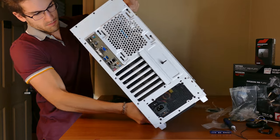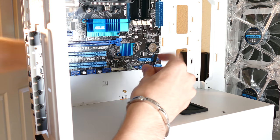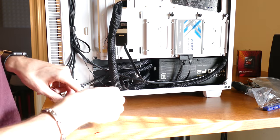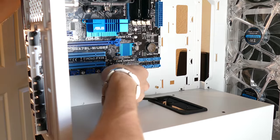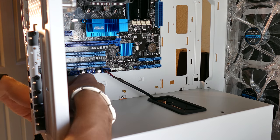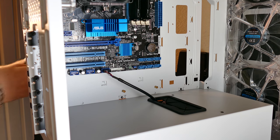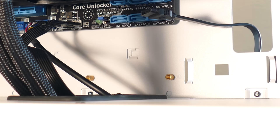Now turn your case back on its feet. There should be a strand of cables along the back of the case that connect to the front I/O ports, USBs, the power and reset buttons, etc. Our motherboard doesn't have a USB 3.0 header, so we can set that blue cable aside. But we do need to wire our hard drive LED, power button, reset button, and power LED leads. There should be a header on the motherboard with corresponding labels down toward the bottom — if it isn't marked, locate it in your manual and connect the cables to their respective pins. Don't forget about the HD audio cable either, which plugs into a header on the bottom left side of this board. Use the gap in the pin array as a guide. If USB 2.0 cables are present, plug them into their respective headers at the bottom of the board. Then pull the SATA cable connected to your SSD up through a cutout and connect it to a marked SATA hub on the board.